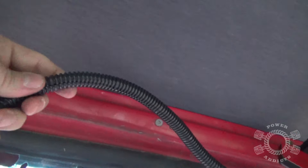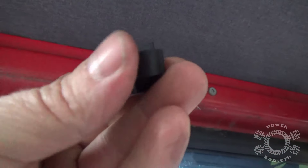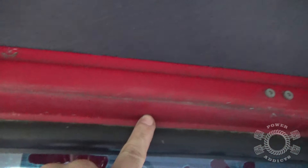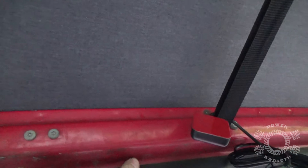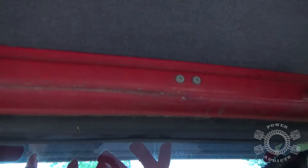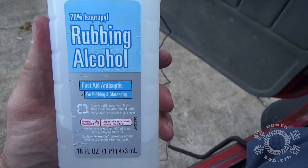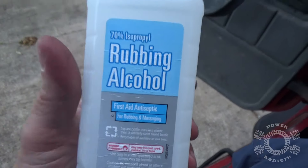To keep my wires in check — neat and tight — I've got them running through this tubing right here, and I want to stick it up along the windshield. I'll be using these clips to snap that into. One thing I do recommend: obviously it's not exactly clean up there, so get your paper towel and clean it out real well, then come back with isopropyl rubbing alcohol and wipe it down real well. That way these adhesive pads will stick much, much better — just plain Jane rubbing alcohol like you pick up at the store. Nothing special, does a wonderful job of cleaning.